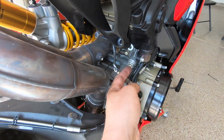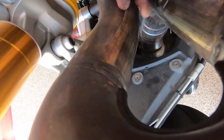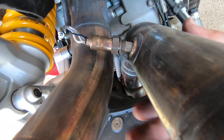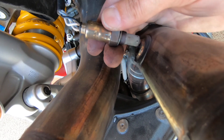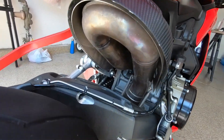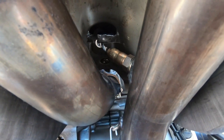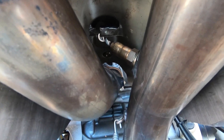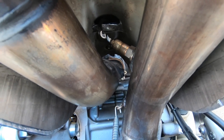One thing I didn't show in the video: you do have to unscrew the oxygen sensor, which is on the inside, and you have to do it from underneath. It's a bit of a pain, but just keep working on it. Make sure when you put it back on you pre-twist the wire so when you screw it back on you don't have a bound wire. Here's a shot of where the O2 sensor is reinstalled — you can see I've got a little twist in the line there.